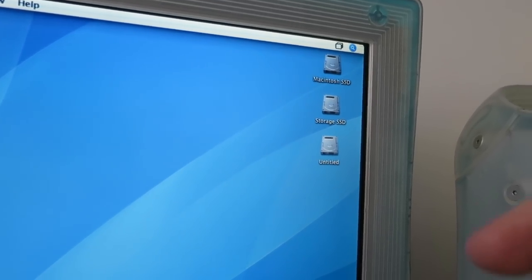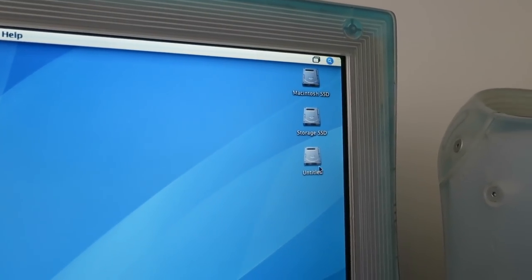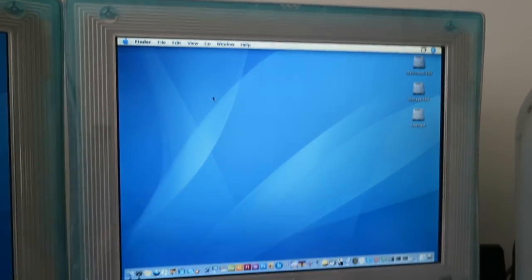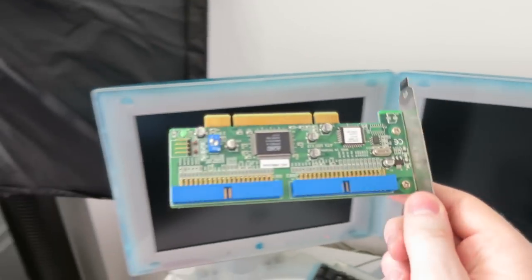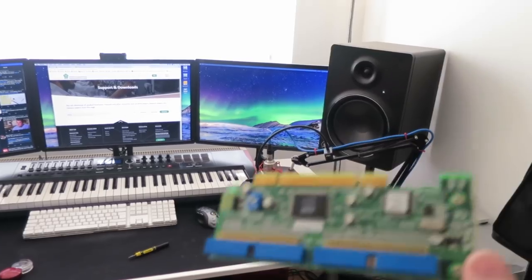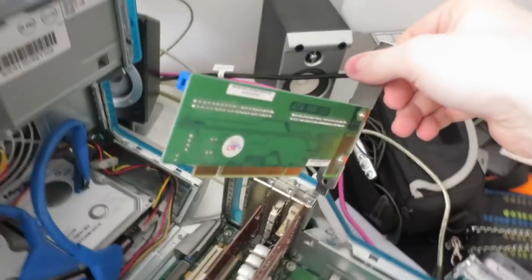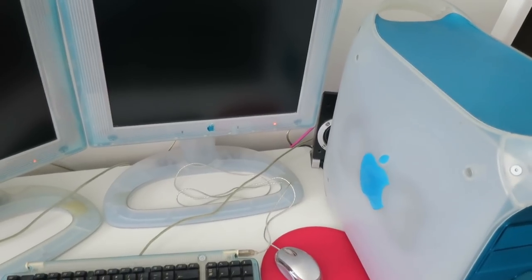The card is still working okay. I've just changed the jumper settings and it is seeing the drive — this is only a 250 gig capacity because I'm not set to RAID 0 at the moment. I'm going to put it back to the RAID 0 configuration and see if a little jiggle around helped. I took out the card to find the model number, looked it up, found the card but can't download the manual because something weird is going on with the website. No joy yet — fiddling with different switch configurations to see what drives appear and how it's behaving.